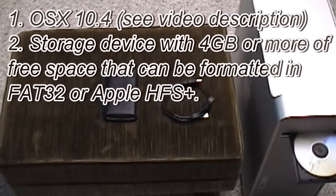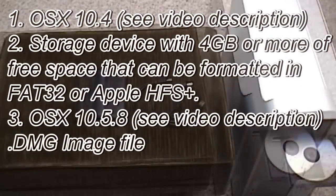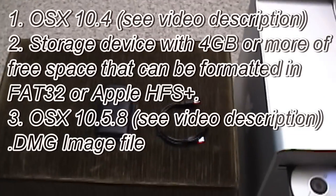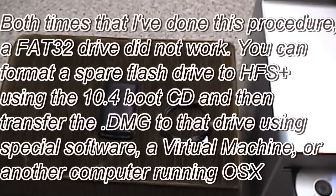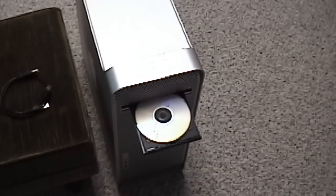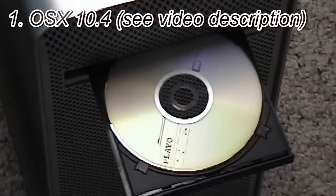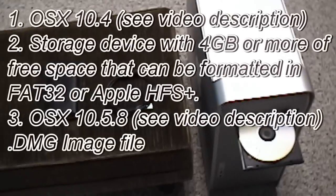OSX 10.5.8 comes in a DMG file, which can't be burned to a DVD. It has to be on a USB stick or a hard drive formatted in either the Apple HFS Plus format or FAT32, and even with FAT32 I've had some problems doing this in the past. So all you really need, in a nutshell, if you want to install OSX 10.5.8 on your G5, is the OSX 10.4 install DVD, which I'm sure there's a link to in the description, and the OSX 10.5.8 DMG file, which is also probably linked down there.